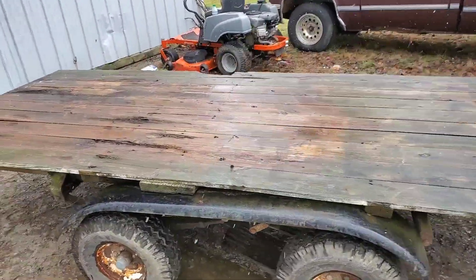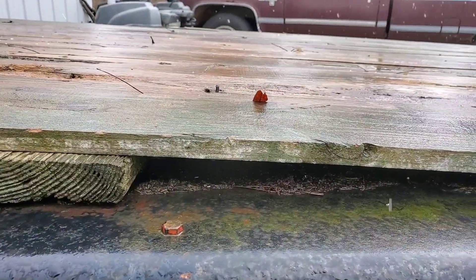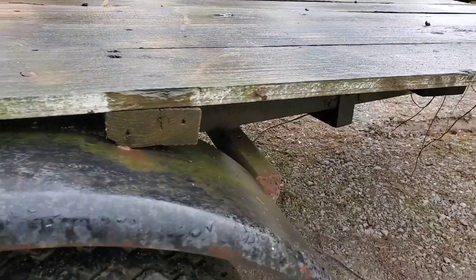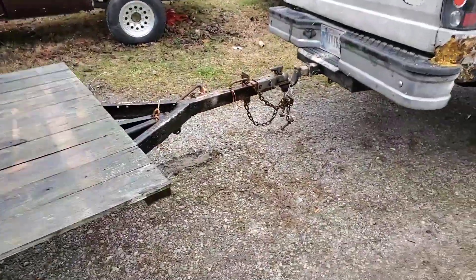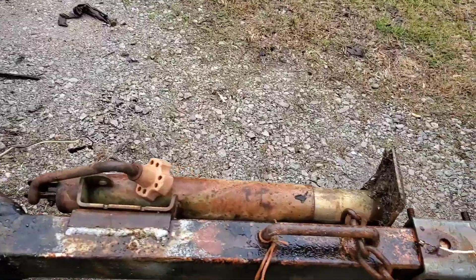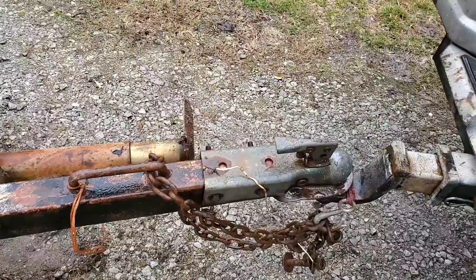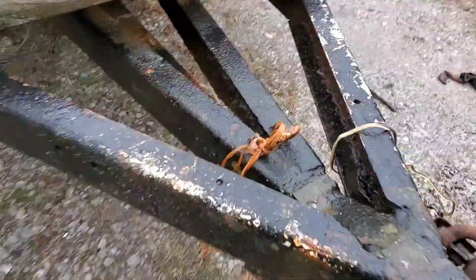Like I said, it's probably six to eight feet long and three or four feet wide — not huge. There it is. As you can see the deck is pretty shot, there's quite a bit of rot in it. They used some — I call it fence planking — little half-inch thick boards sitting on top of what looks like a two-by-twelve or two-by-six, and some two-by-threes. You can tell the deck is shot. The jack works, the receiver is busted and just bolted on, which we're going to change. We're going to take apart the receiver and try to clean up the mechanical aspect because it keeps getting stuck — you have to pry it open to get it on and off.